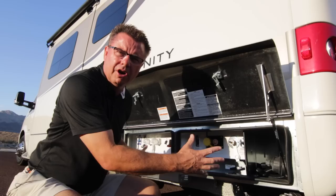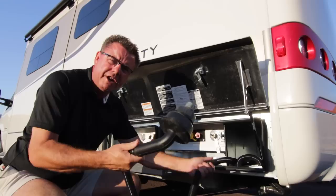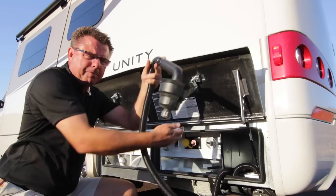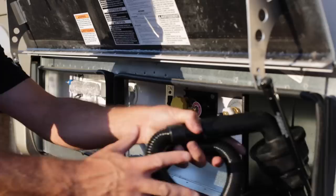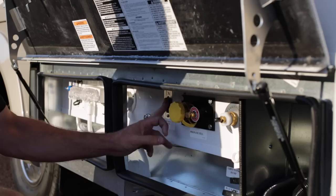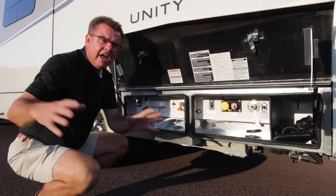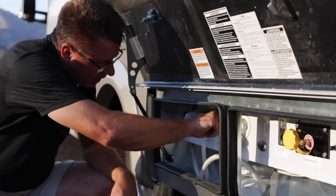We have our optional macerator pump. People always ask about the advantage — it's small, easy to maneuver, already connected, and it can pump uphill if needed. It's motorized. Always pull your black tank first, then your gray. We've got a remote propane fill, and a safety switch — you can turn your propane off instantly. There's a little light inside for nighttime. Here's where you fill your fresh water: the hose locks in here, and turning the valve fills the tank. When plugged into shore power, turn it the other way and you use city water instead.